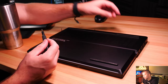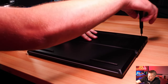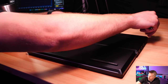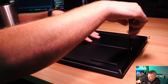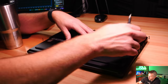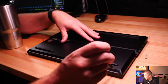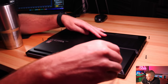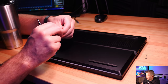The key when dealing with a power adapter that's under supplying power to the laptop is you either have to reduce the amount of power the laptop is using, or you have to upgrade the power adapter. Usually that's one of the two situations. And if it's not configured correctly, it can drain the power from the battery to help supplement the power the system needs to operate. And that's usually not a good thing, right?